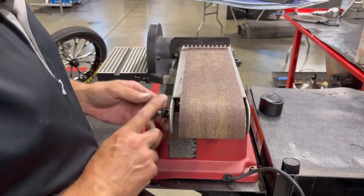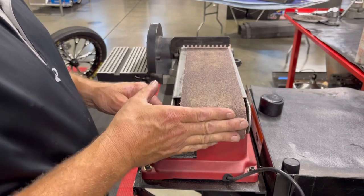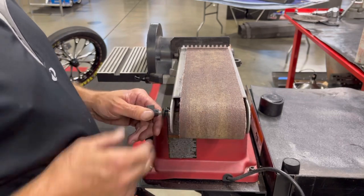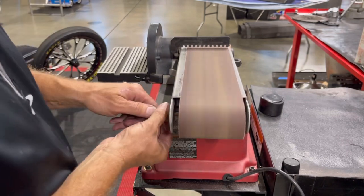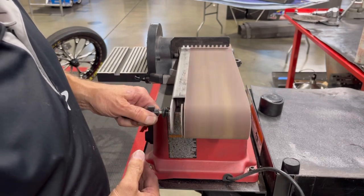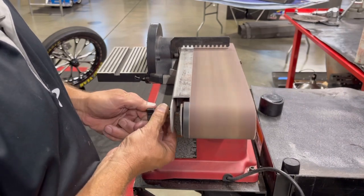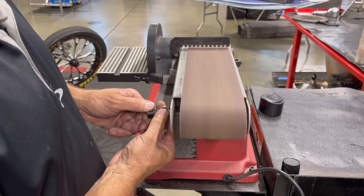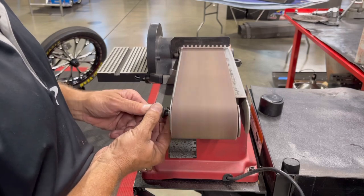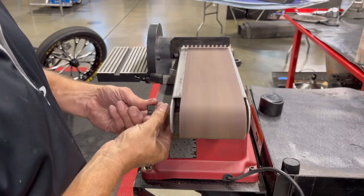When I run this knob in, we'll pretend this is the snout of the blower lifting the front up on this side of the flat pulley. You can see which way it makes the belt move when I run it in. Pull it back out — same thing — it'll run off the front. Too low, it'll run one way; too high, it'll run the other way.